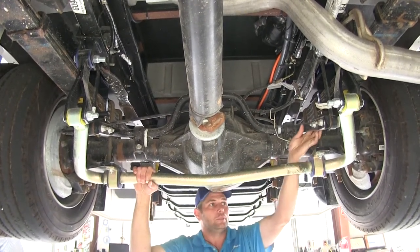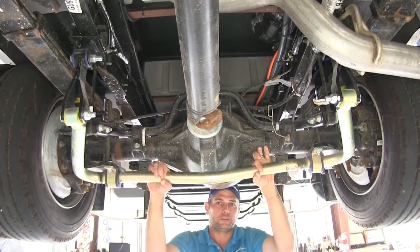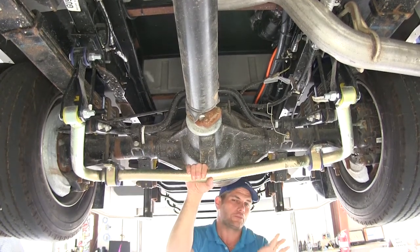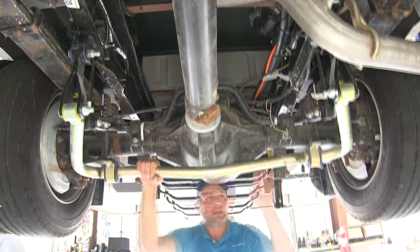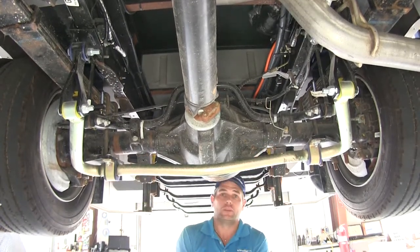On the rear, we're going from what is typically an inch and three-eighths sway bar up to an inch and three-quarters — adding this in addition to the stock bar. On the front, it's typically a sway bar replacement — removing the inch and three-eighths and putting in a heavier duty bar. These are often made out of chromoly steel rather than standard steel, giving a lot more stiffness and rigidity, and again addressing body roll on the back of the RV.